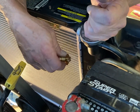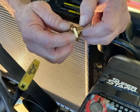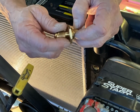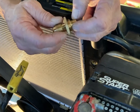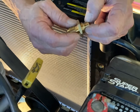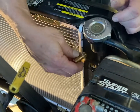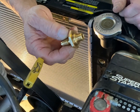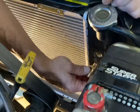I wish I'd have known about it, but now I've got so much fluid in there I'd never get it all cleaned out. I would have put the 515 sealant, I think it's 515. It's a red sealant. Anyway, it's a red pipe sealant, but it's actually a thread sealant, and it's kind of a gel. It's in a tube. I think the number's 515. Don't quote me on that. I would have put that around there first, but since it is tapered, I can use regular Teflon tape, wrap some around it, then tighten that down.